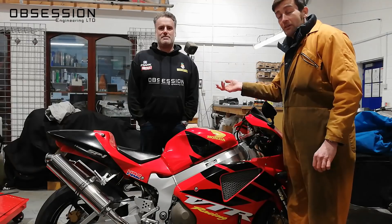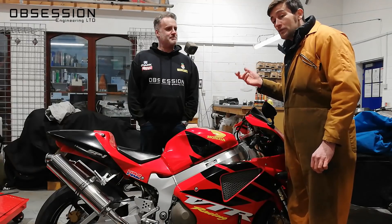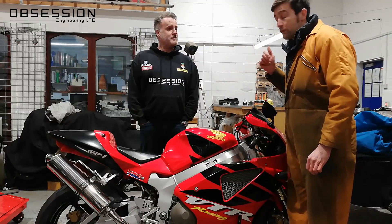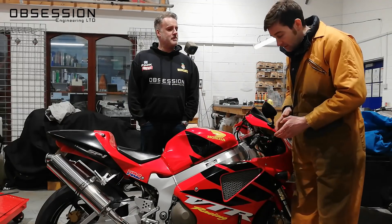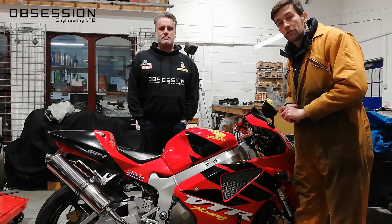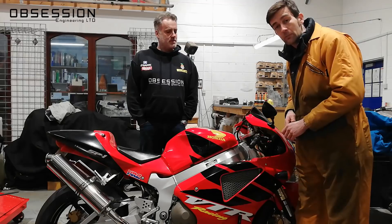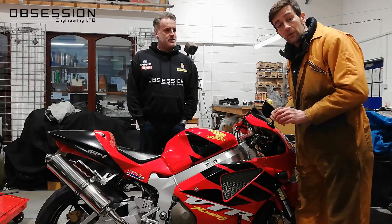This is my friend Phil and he's going to be helping me today. If you don't have any friends, you can still probably try and borrow a Phil. The first thing we need is a full-length measurement of the front suspension. Phil is going to lift the front of the motorcycle up, pivoting on the side stand, and I'm going to take a measurement.